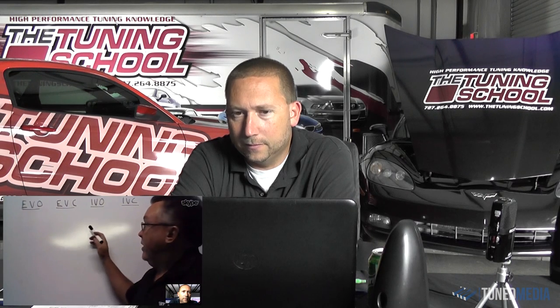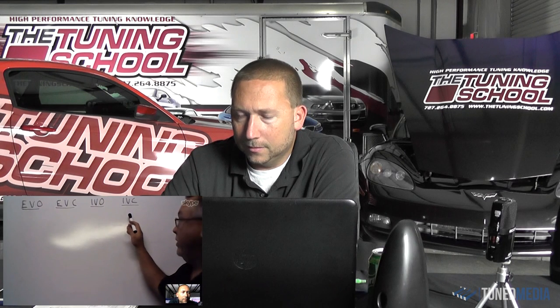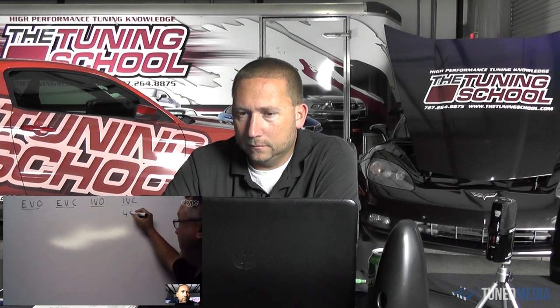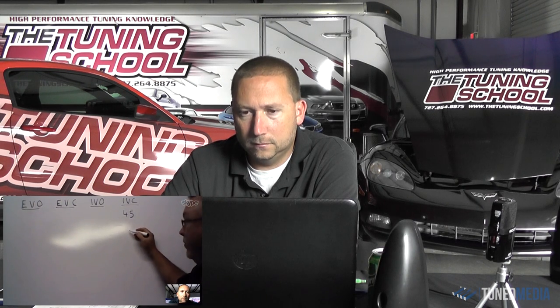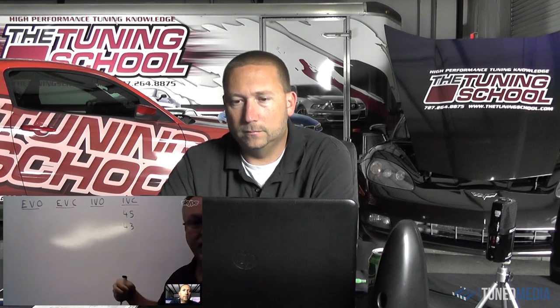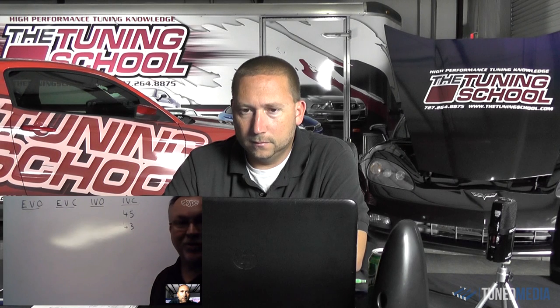All right, so let me kind of work us back into when you're building a cam for a customer with a forced induction application. Is it specific to centrifugal and then positive displacement or turbo? Absolutely. Because centrifugal supercharged cars almost always make good peak horsepower because it continues to build boost. They tend to be laggy in the mid-range, so we actually crutch the cam where it makes better mid-range torque. The number one way you control torque and horsepower is intake valve close. Where a naturally aspirated cam from us may have, for LS1, LS2, 45 intake valve close, if it's centrifugal supercharged, we may pull that back to 43. We're actually closing the intake valve earlier to help build mid-range torque, to help crutch the missing torque from the centrifugal supercharger.